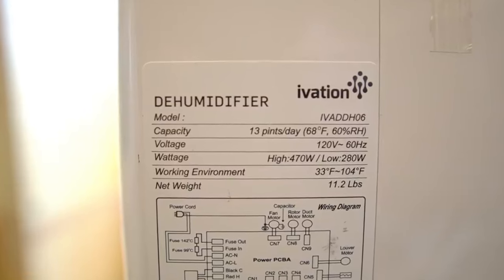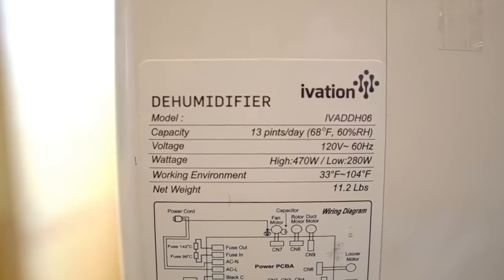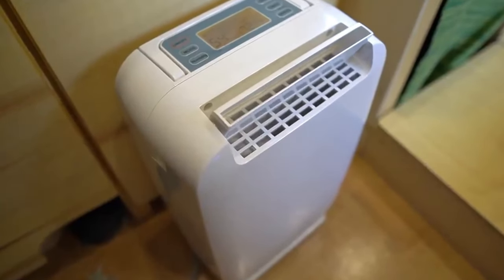This item is also a little bit pricier than the other items, but for us totally worth it. Just one final note about dehumidifiers: we've tried the compressor-style dehumidifier, which was bigger, louder, and didn't work as well in low temperatures. We've also tried the really small ones that use Peltier technology, and we found that those didn't work at all if it was not in a warm climate.